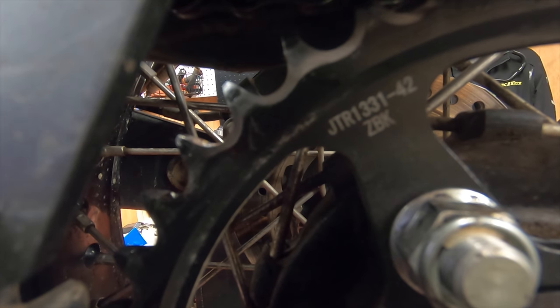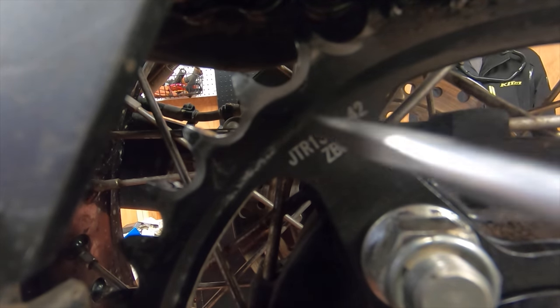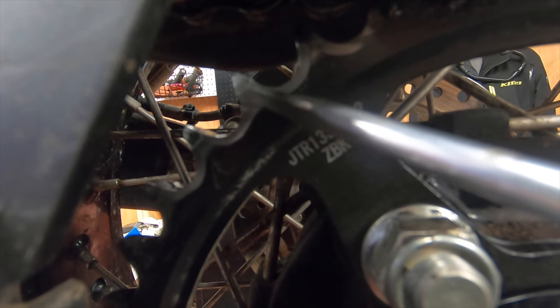Over time, as the motorcycle turns this tire, it pulls on this edge of this side right here. On a chain or sprocket that's starting to get worn out, this will start to be almost like a shark tooth effect. It'll be very narrow here and then kind of go onto your bowl, and then this will be virtually unworn. So with lots of acceleration and hard riding, you'll start to get wear on this side. On the flip side, if you do a lot of deceleration, like engine braking or a lot of downhill, you'll get some wear on this side.